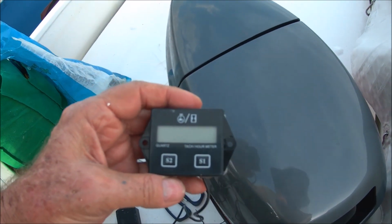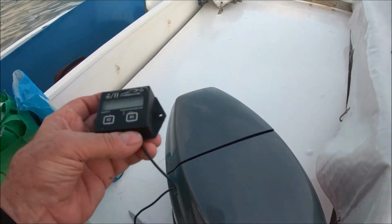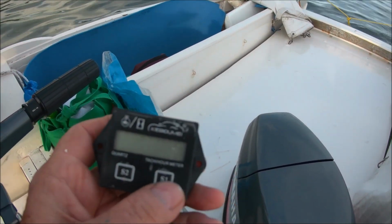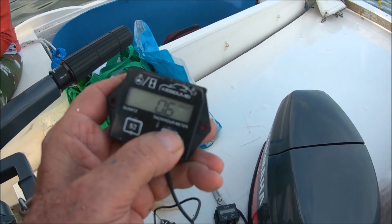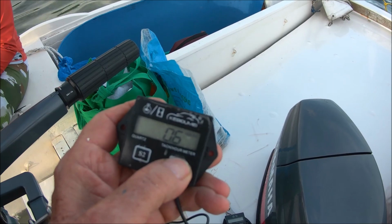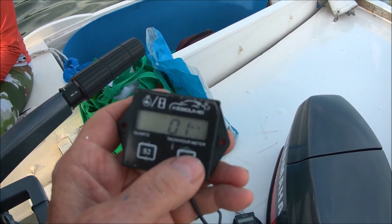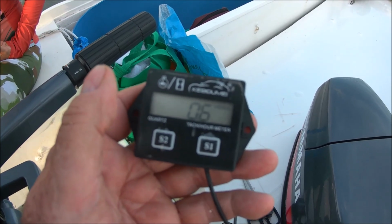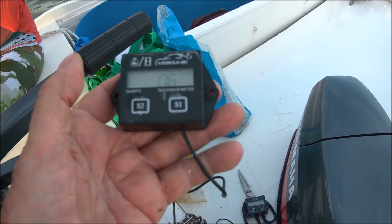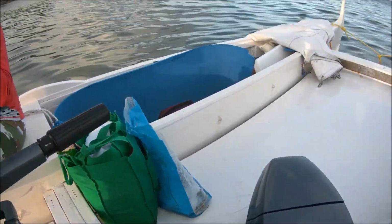We set this new tack that we got here to 2-stroke 2-cylinder. And on this one, you're supposed to hold this S1 button down here. See that S1 right there? Supposed to hold that down for 4 seconds, and then it should change to, okay, this says 1. See that 1 RPM? That's a 2-stroke 2-cylinder engine. So it's set properly right now, but it wasn't reading properly.